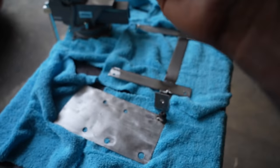I made a little bit of a modification to the plate and I want to talk about it. You may see that I scraped the paint on this side here. The reason for that is because the negative side of the battery is going to tap into this side here, and we want this plate to conduct electricity. And also if I want to get any other negative or ground wire, I can always get it from this plate as well. So that's why I scraped the paint, and I actually did it on both sides, this side and the back here as well.